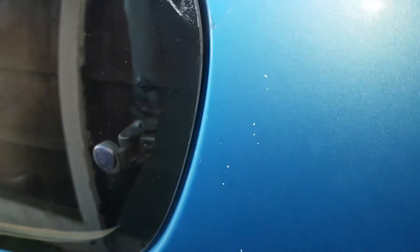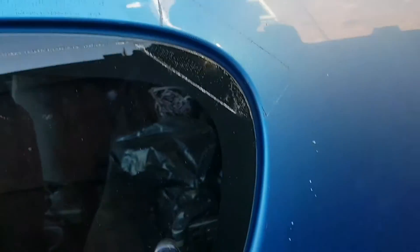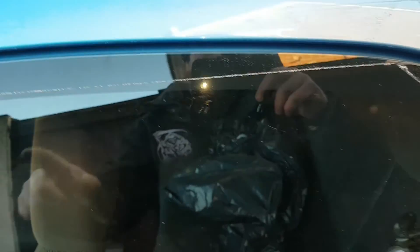Make sure your window's level when you put it back on before you tighten it up. Both sides have been done. Just get a bit of water on it around the top to make sure it's absolutely sealed and you're going to have no leaks. That's the 107 windows — that's how I fix them with some tiger seal. Works a treat, stays on, doesn't come off. Anyway, I'll leave it there for today, see you next time, stay safe.